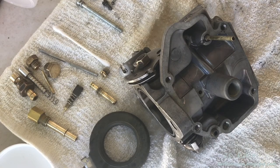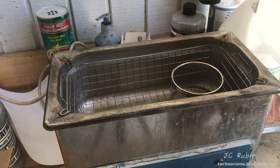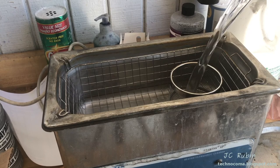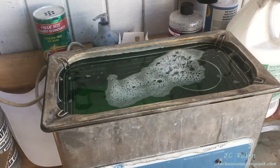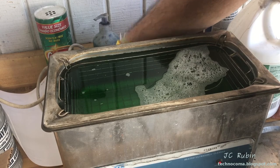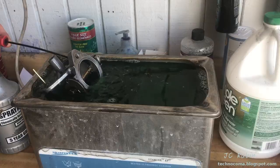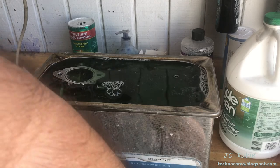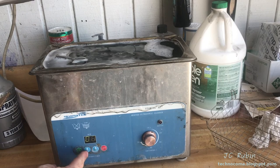This tube for the enrichener — I'm going to clean this tube even though it's going in the tank. All the ports are open and flushed out — it's ready for the tank. I'm going to fill the ultrasonic tank up with distilled water and leave room for about 200 milliliters of Simple Green, then for superstition I always add just a little bit of dish detergent. I'm going to let it come to temperature and then bring it up to 70 degrees centigrade. These have now come to temperature — I'm going to start them on the first of two 20-minute intervals.